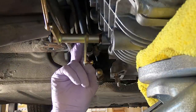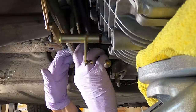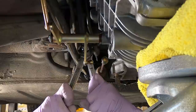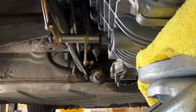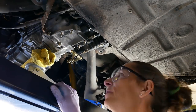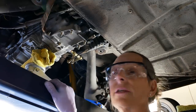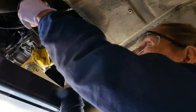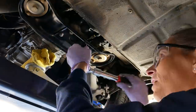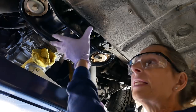We'll do our other one here as well. Loosen that guy up a bit, nice and loose like that, then go back and tighten it again. Okay, that's pretty tight. So I think what I'm going to do is go ahead and remount the transmission back up just to be safe - this engine jiggles around quite a bit, and if it fell off the lift it would be absolutely disastrous. Let's go ahead and put this big crossbar back in and tighten things up. I won't torque it all down yet until we're super certain that everything's good. I think that's tight enough at least just to test it.